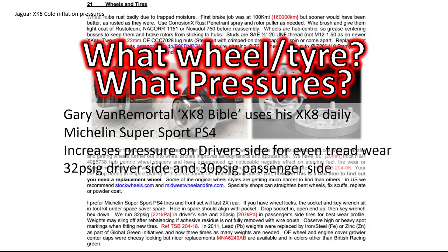Other people, for example, Gary Van Remortel, I've read his XK8 Bible. If you haven't, and if you've got a Jaguar XK8 or XKR, particularly a 4.2 one, it's a must to read. I'll put a link in the description. He uses this daily, and interestingly, he's using Michelin Pilot Super Sport PS4s, and he increases the pressure on his driver's side. Because obviously, if you're using it as your daily drive, you're usually driving on your own, so you're just sat on the one side of the vehicle. He's increased the pressure on the driver's side by 2 psi as opposed to the passenger side to get even tread wear, which I thought was really interesting. He's using 32 on the driver's side and 30 on the passenger side.